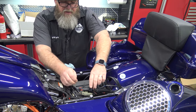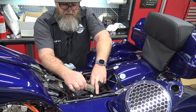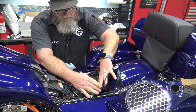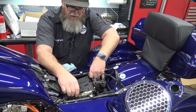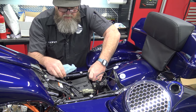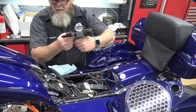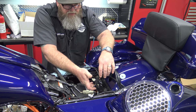I like to just take a towel, put it over here on the side and set the ECM on it so you're not scratching your side cover. Once we get that out of the way, you've got your battery tray right here. Over here on this side, you'll have the gray plug that goes up to your fuel tank — pop that off. The black plug that goes back to your taillights — pop that off. The top of your battery tray lifts up in the rear. Make sure you're not pulling on any wires. Push the battery tray forward towards the front of the bike and then lift up the front, and that cover will come out. Now you've got a little bit more room to get your hands in there to get those two nuts on the bottom.